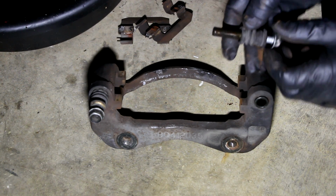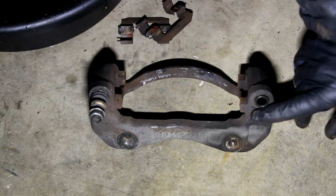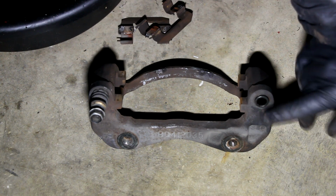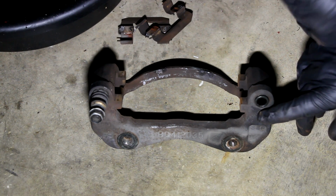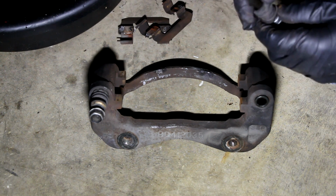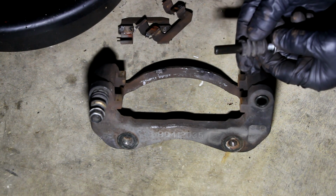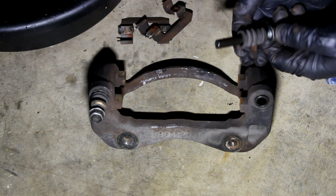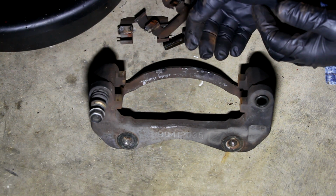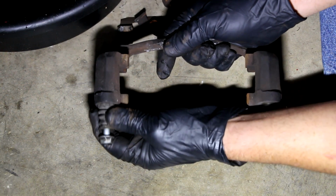And I would probably suggest to stuff something inside these holes prior to grinding this down. Again, keep it dirt free, and then after you're done, clean them out too. Again, brake clean and then re-grease these sliders. These sliders seem to be okay though. And the rubber seals are good too, so there's no need to worry about them for me anyway. So check that while you're doing it. Check your brakes and stuff to make sure everything looks good when you're taking them apart, and anything you find that is not right, definitely replace it or fix it.